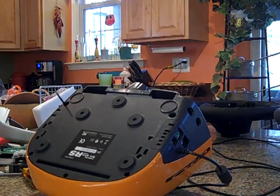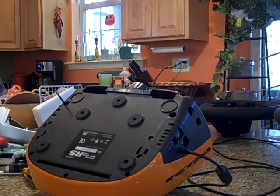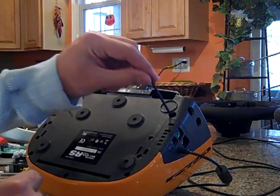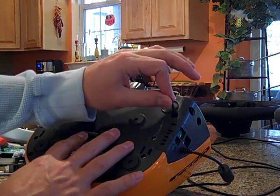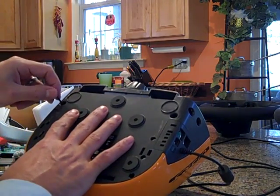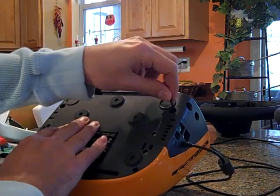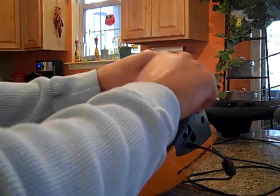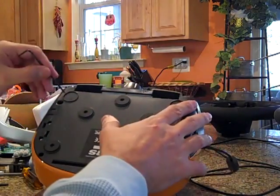One interesting thing to note about this Turbo S wheel versus the other wheels that I've been using, the GT3RS wheel, is that this one, the number 3 metric hex does not work in these longer bolts. For some reason this wheel is put together all with 2.5s. So the same wrench that works down here works up here as well. Thought I was doing something wrong at first. So I'll get these loosened up. And then the cover should come off.